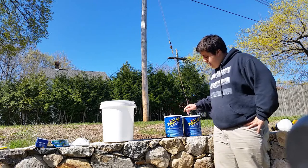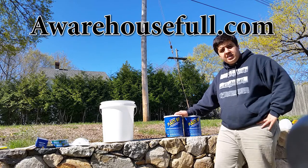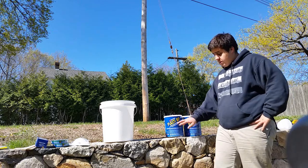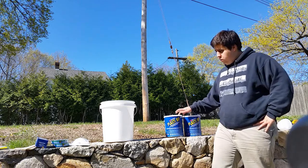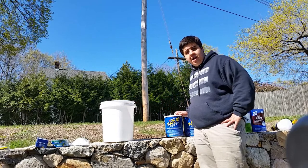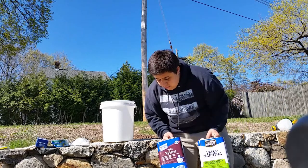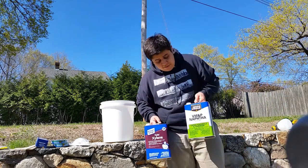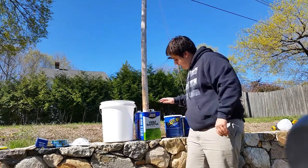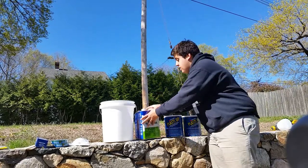What I'm going to do is, I have 2 gallons, I got them from a warehouse actually, wicked cheap, for like $55 each, with overnight shipping, it was awesome. These are pre-thinned, unthinned, and I'm going to mix both of them into the bucket, and then I'm going to double how much Plastidip I have by thinning it. The thinner I'm using is 50% xylene and 50% VM&P. The ratio you should go with is, for every 1 gallon of dip, you add 50% of this and 50% of that. So let's get mixing.